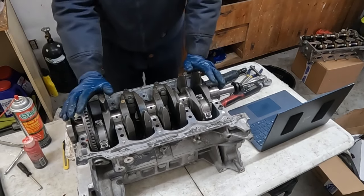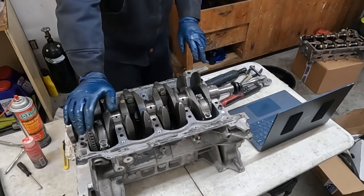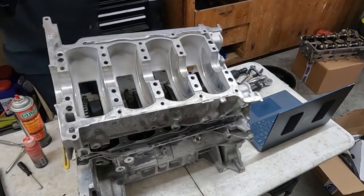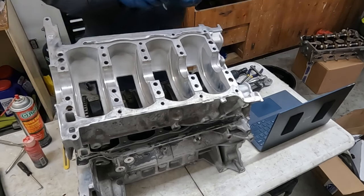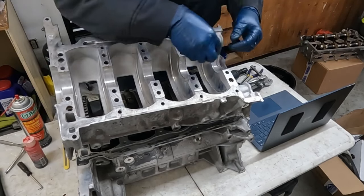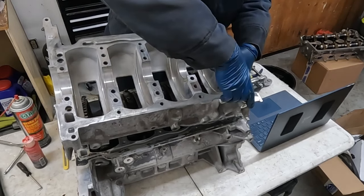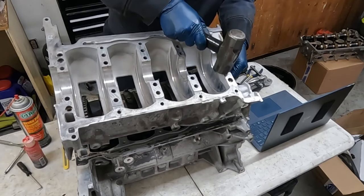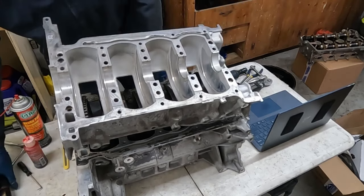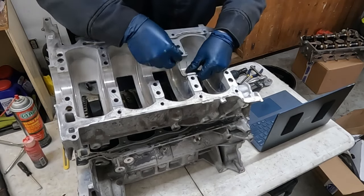So now let's put our crankcase on. That will have its own bearings for the main bearings for our crank. Let me find that and get it ready. So same thing on this. This is the front, this is the rear. We're just pressing in our bearings. Protrusion, groove. That's pretty much it. Just push it in. Tap it if we need to. The second one is our thrust bearing.